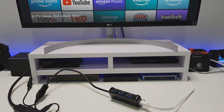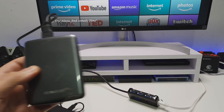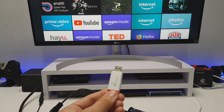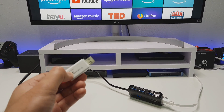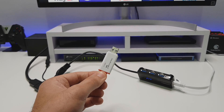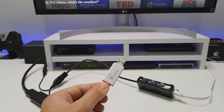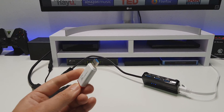To expand the storage, we can use any USB drive that can get enough power from these USB ports. I have a 2TB Samsung USB 3 drive here, but in the interest of time I'm going to use a smaller USB 3 drive. Let's plug that in — we should then see a prompt on the Fire Stick asking us to format it. The only requirement is that the drive is already formatted as FAT32, so the Fire Stick can read it and then format it ready for use.